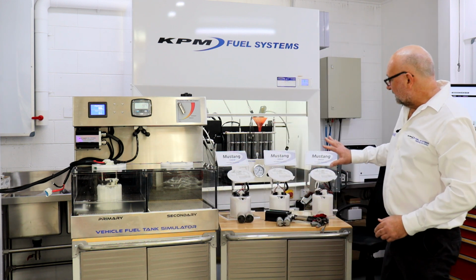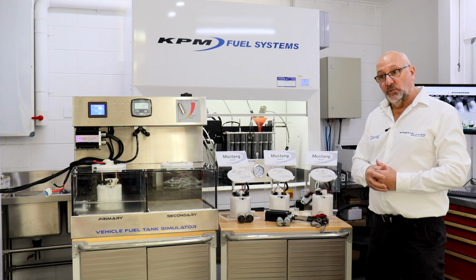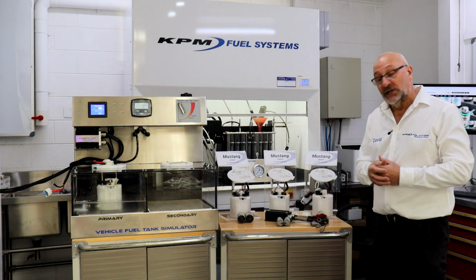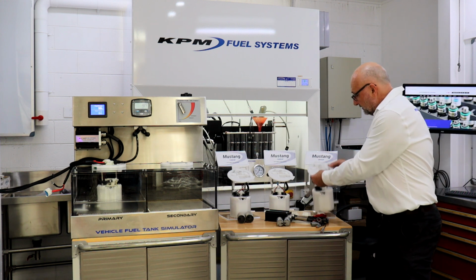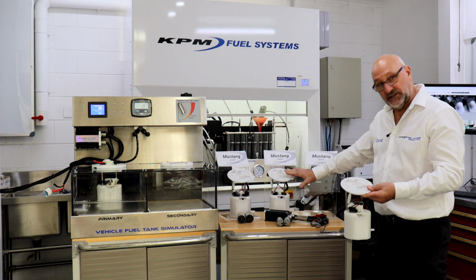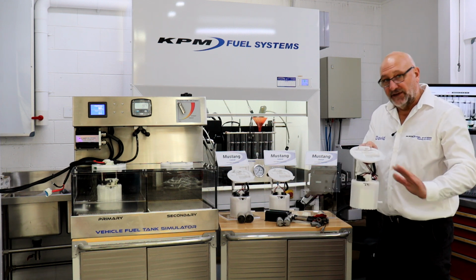Now I just want to explain, I'm going to concentrate on the 800 and 1000 horsepower systems just for a minute. They are a true direct plug-in. What you'll do, you'll take your rear seat out of the Mustang, the 15 to 23 Mustangs, the FM models. Take your rear seat out, pop your standard module out. Your standard module pretty much looks like that. Put the KPM fuel system in there, the 800 or the 1000, either one. Plug it in, away you go. Nothing else to do.